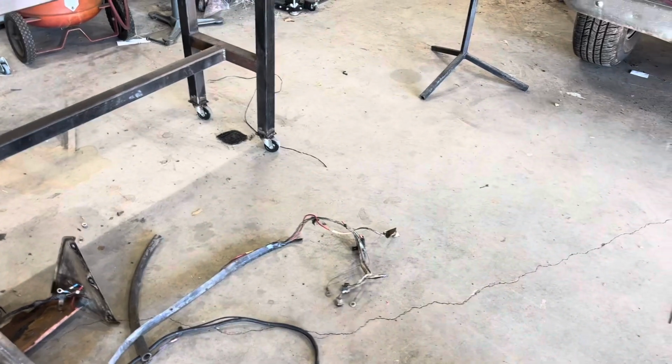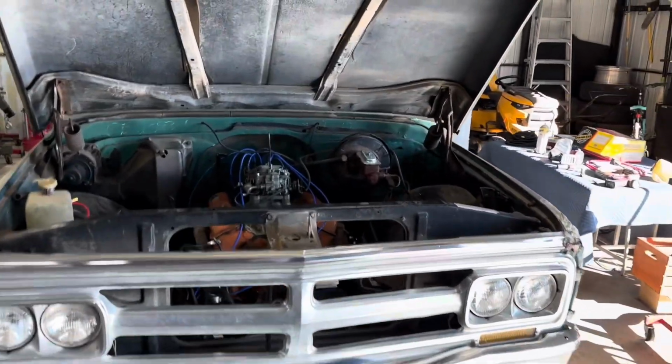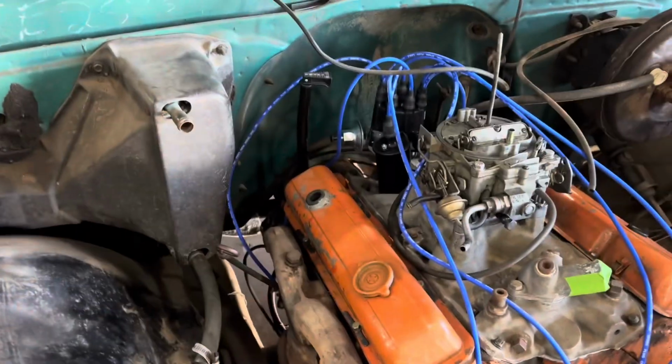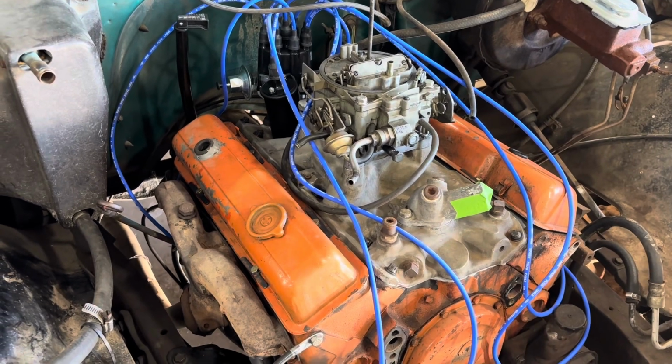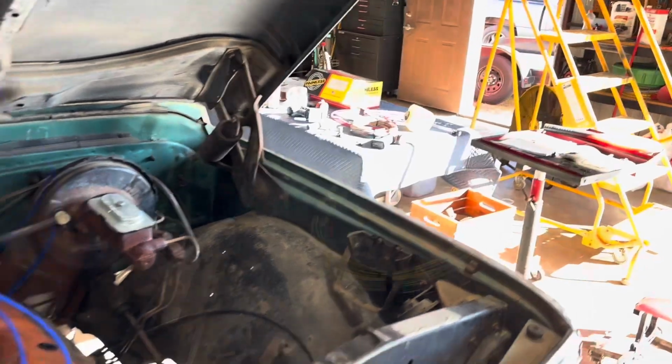So it's a much simpler time with the wiring back in the day. So just something for lighting, one 12-volt wire switch for ignition, and you're good. So we proved that in my last video, or one of my first videos, where we got it running with just a 12-volt switch to the coil, and that's all it takes to make an old school car start and run. So now let's get that new harness laid out.